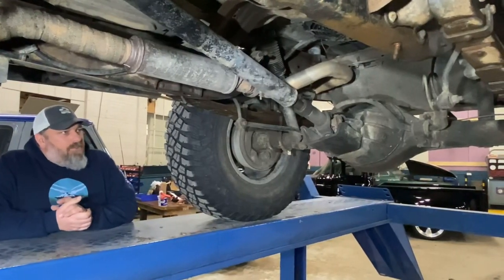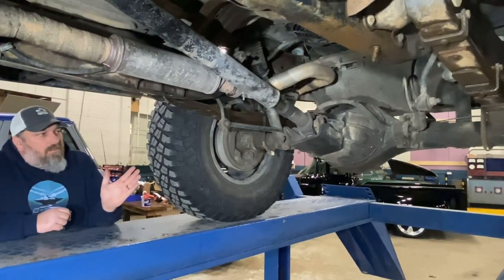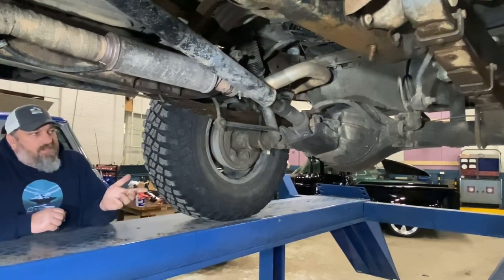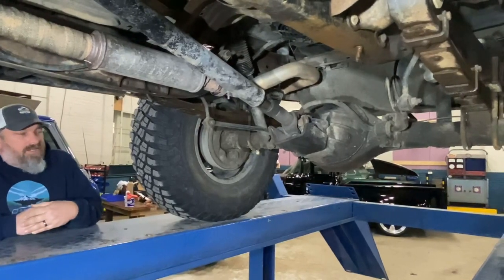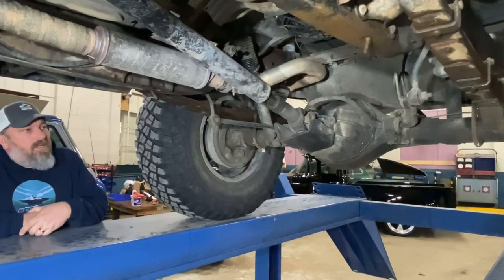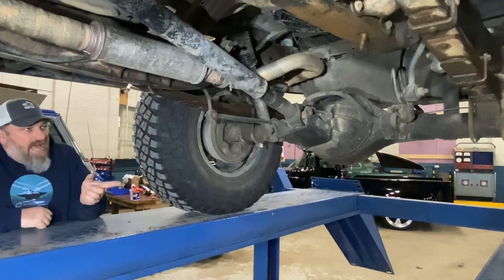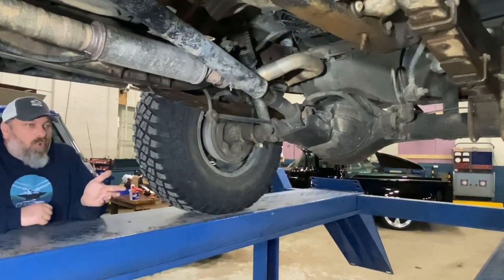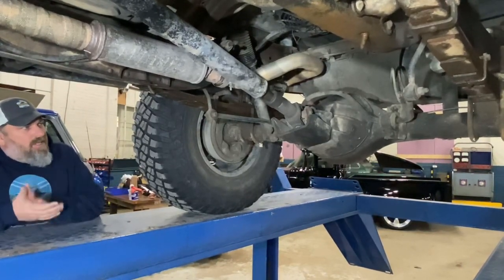And coming to the back of the truck, what we have back here is an early Bronco. This is a one year only, I'm told. '76 9-inch narrow width for the early Bronco, but it is the big bearing. I think they call it the 6500 GVW version of it. So it came with the big 11-inch brakes, the big bearings. Inside of it, we have a set of 456 gears. We have a full spool and 31 spline Superior chromoly axles.